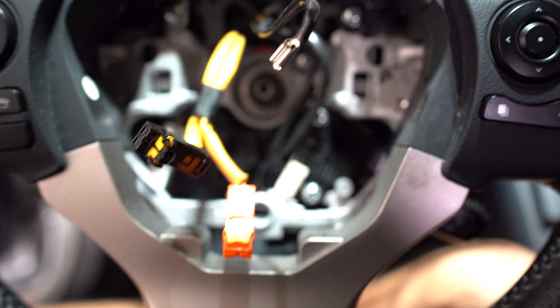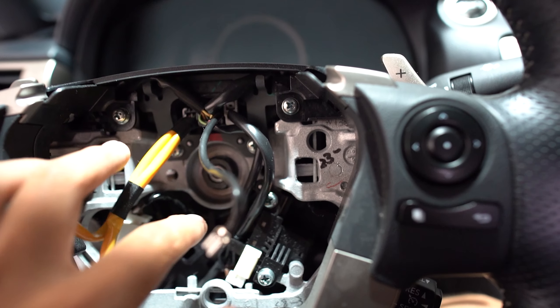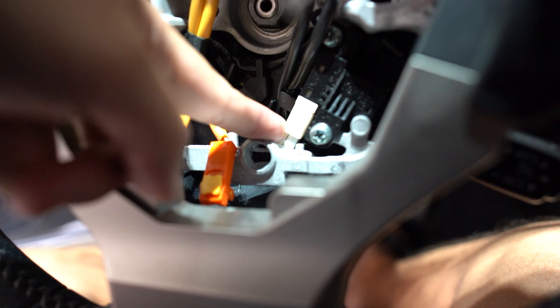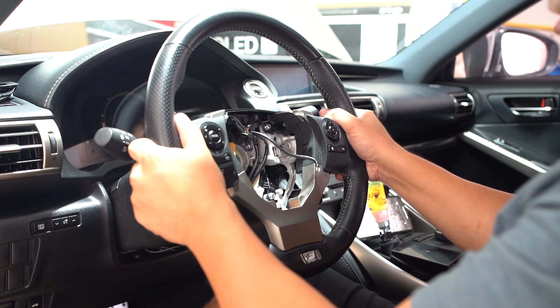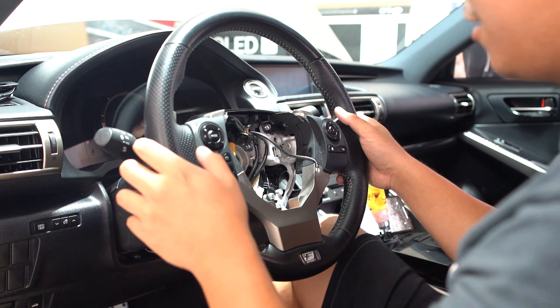Now there are a bunch of Phillips screw heads here we'll remove after taking out the steering wheel, but right now we just need to unplug the harnesses — there's one at the top and one at the bottom. The black one on top has a release pin in the middle; clip that down and pull it out. The bottom one also has a push-tab release, so push that down and slide it out. Now it's a 19mm nut, so we need a 19mm socket. It's stuck on there, so wiggle it back and forth and use full force to take it out.